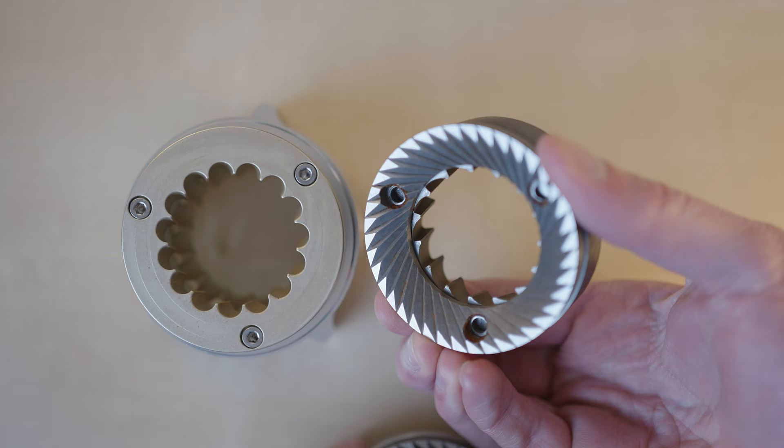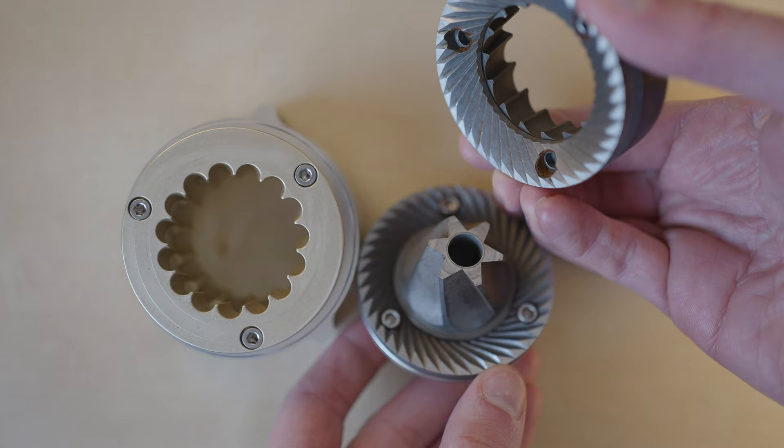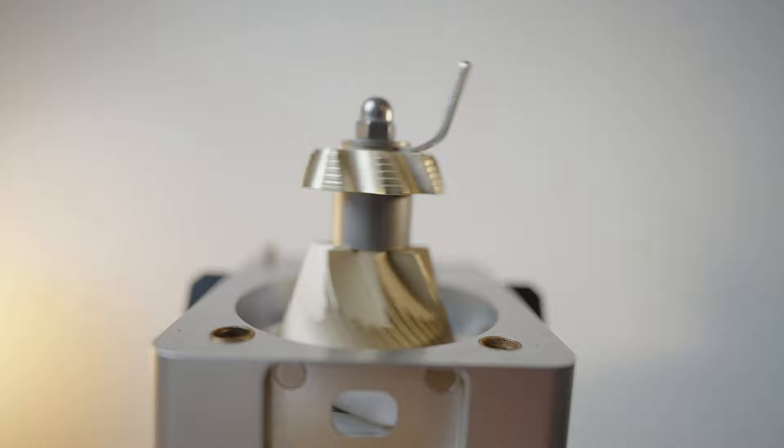This is the second dual burr system I'm aware of that's available, but how does it compare to the Versalab DRM hybrid conical and flat system? Besides using this coarse-breaking conical set, Kofitek stresses that a key difference between this and the DRM system is an intentional buffer space between the burr sets — they aren't stacked directly on top of each other. This is to allow particles to be fed at a more consistent rate into the fine grinding portion of the 71mm set, by allowing the spacing and the coarse section of the second burr to act as an auger for feeding.